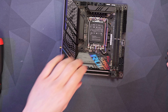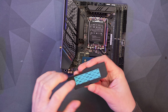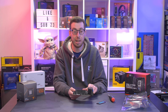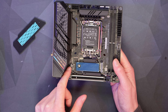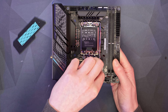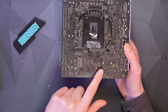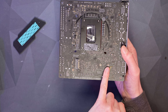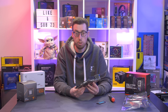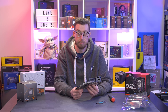At the bottom of the board is a PCIe Gen 5 slot for your graphics card. Above that is the cover for the first M.2 heatsink, secured with three screws. Removing it reveals a thermal pad on the back of the aluminium cover. The first M.2 slot supports up to 80mm Gen 4 drives and has a quick-release mechanism. On the back of the board is an additional Gen 4 M.2 slot, also up to 80mm, using the standoff and screw from the box — giving a total of two Gen 4 M.2 slots.